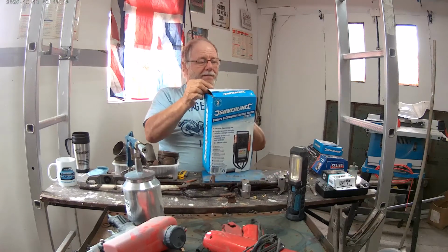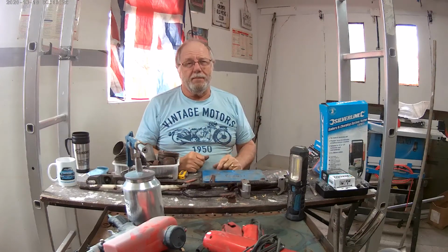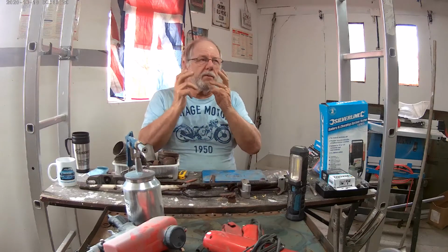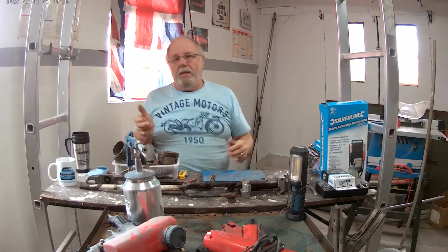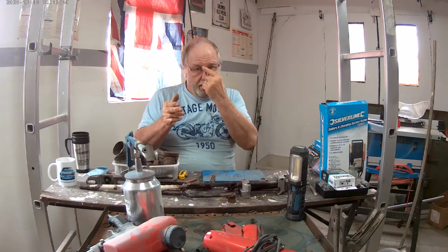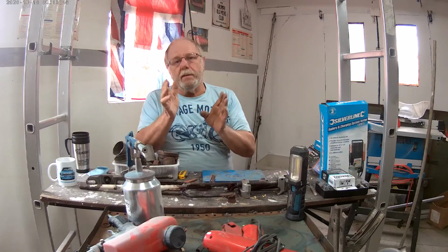I mean, there was a scrapyard near us. They were selling batteries with a month's guarantee for 20, 30 quid. The batteries that people have taken in, thinking that they're bad, and they're not. All they need is a bit of TLC, a bit of tender loving care. Top it up, stick it on the battery charger. Sometimes they don't work, give them 5 minutes, then they'll spring into life.